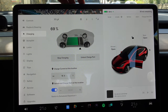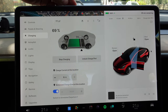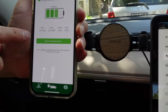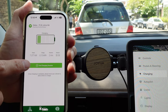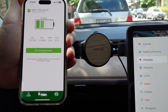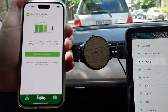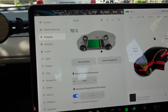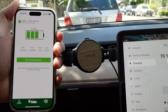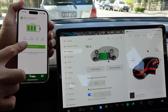You're limited by your car's capacity, so for us it's 11 to 12 kilowatts. We're getting the full 16 amps with 35 minutes remaining to reach 79%. The app says 7 kilowatts while the car says 12 — a little discrepancy that may catch up. Two minutes have passed and it's pulled 0.13 kilowatt hours. Now it's updated to 11.82 kilowatts, which matches the 12 kilowatts on screen. It also shows energy pulled, duration elapsed, and cost so far.